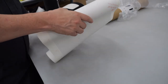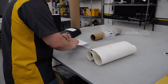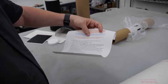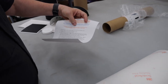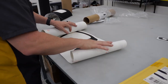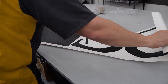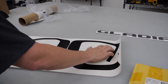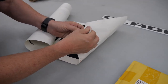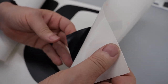I'm just going to cover up the name on here. There are some instructions, and this is going to be a wet install - I can tell by the material. So rolling this out, this is that Gladiator tailgate install. I know this is wet because the backing paper is not ridged. If it's air release or a cast film, you're going to feel and see those adhesive channels on the backing paper. This is definitely a smooth install.